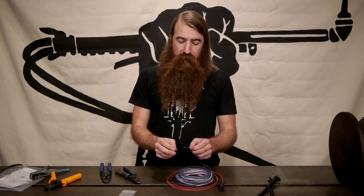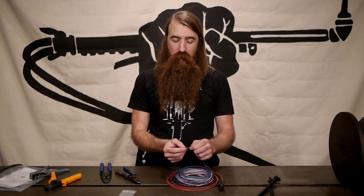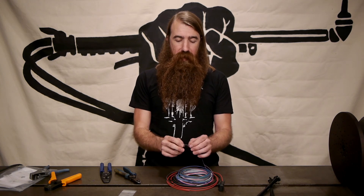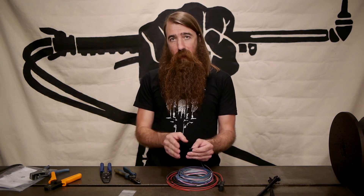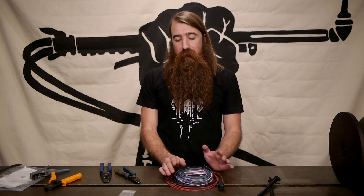There we go — that's a great connection. The part that sticks out here gets inserted into our terminal block, and the heat shrink helps to distribute the stress so that any bending or vibration won't be fatiguing the wire right at the concentration point where it exits from the ferrule. Following those simple techniques you're going to have a great professional installation of this kit. With all of our products at Revival we want to answer all your questions — send us an email, give us a phone call, we're always here to help. Thanks for watching.